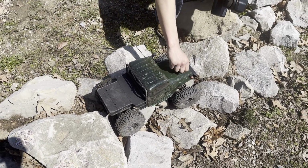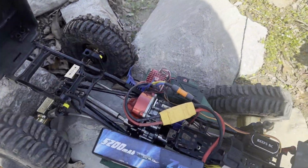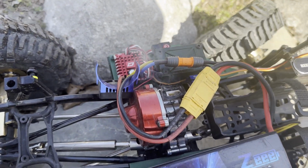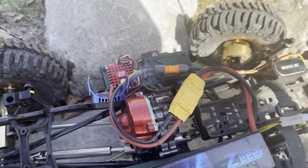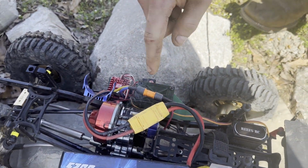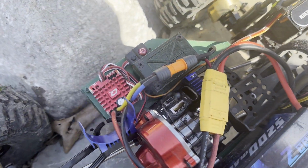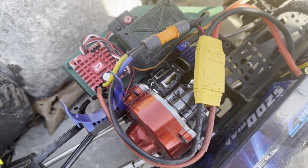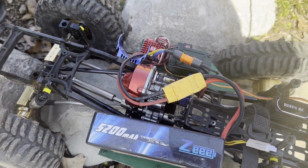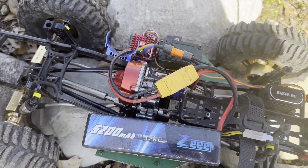Gonna pull the body off of it. Just look at the smoke roll off of it. Absolutely burned it up. The fan fell off of it at some point. Yeah, look at it. You can see all the burnt stuff in there. Motor's absolutely fried. There's usually a fan down in that plastic hole. It's gone through the hole. It had completely melted out of that motor. It melted all the stickers on the motor. All the coils inside turned out solid black. And the motor ended up completely locking up. And the truck wouldn't even roll, just pushing it. Alright, let me look at the battery.